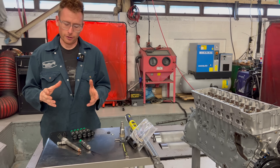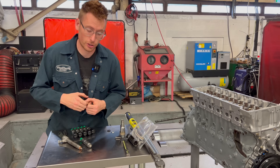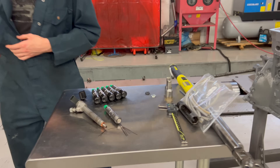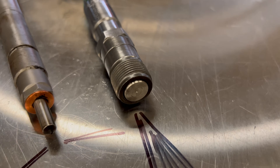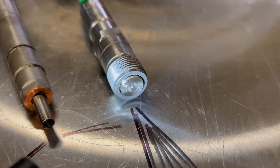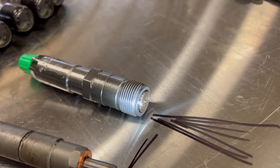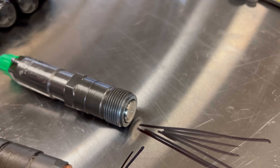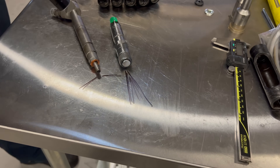What are the major differences? Let's talk about the 606 injector first. It's a pre-combustion injector. If we zoom in — I'll use a torch so you can see the tips — you can see there is a needle sticking out the end like a little point. Basically, when that injector operates, pressure builds up inside, the needle pulls back, and fuel is ejected in a pattern — just a very low-degree cone.